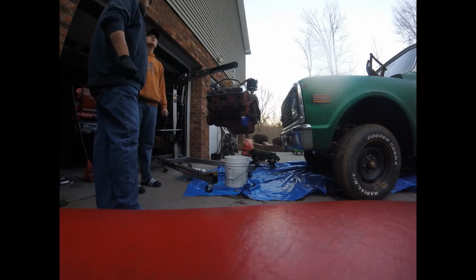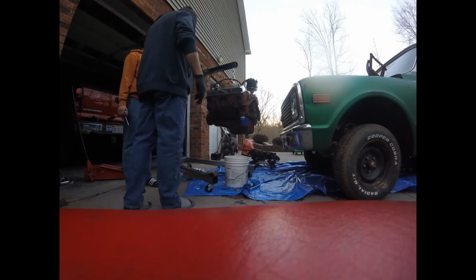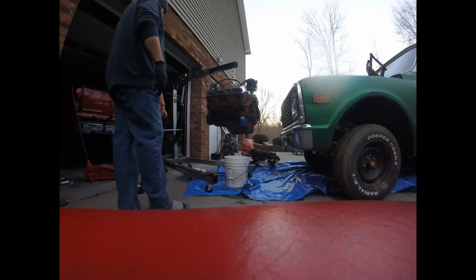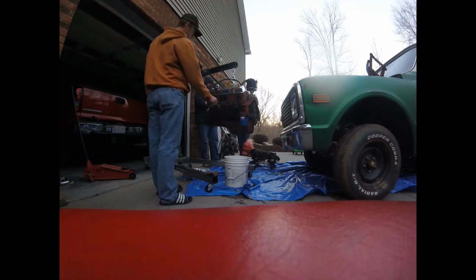Before the motor was ready to go in the engine cradle, we had to drain both the oil and the remaining water and antifreeze out of the block, so that way we wouldn't make a mess all over the floor with it just sitting there. And it also made it easier for when we go to tear it down in the next video, that the fluids have already been drained out of it.